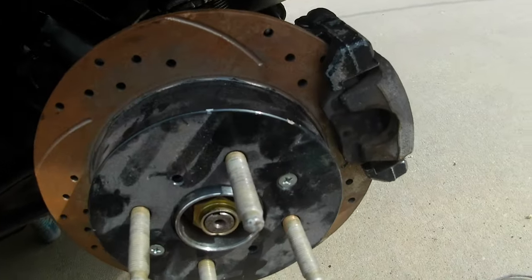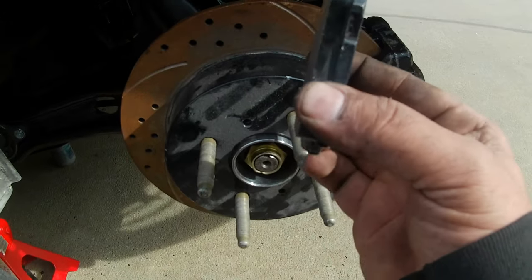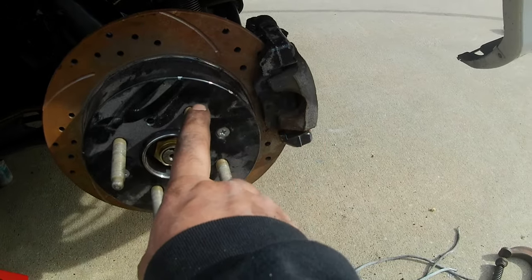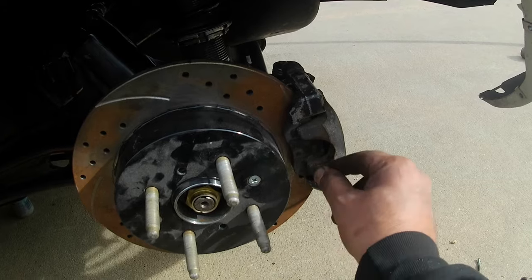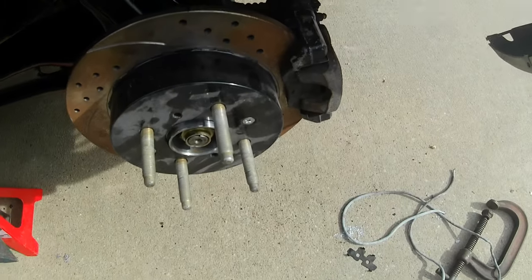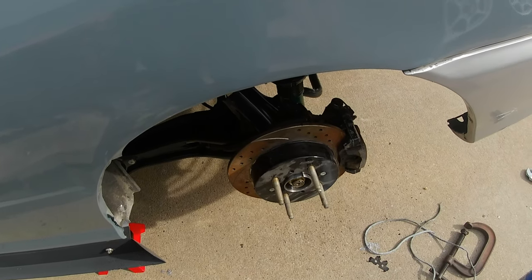This side is all together. Don't quote me on the pads - I thought I could use RSX pads but they seem to be just a hair too thick. I'll update you on the next video when I get the replacement calipers and let you know exactly which ones I use. I just threw the Integra pads in here for the time being; they're a little loose but I don't think they'll fall out, and I'm only pulling the car into a parking spot. I'm going to start tearing the other side apart but probably won't film much since it's the same exact thing.